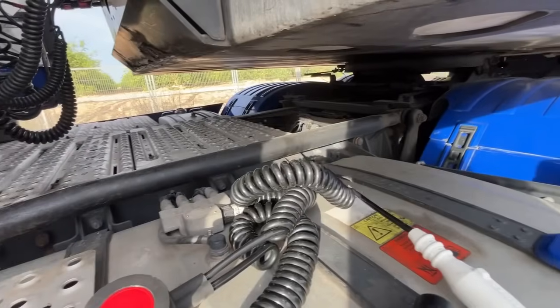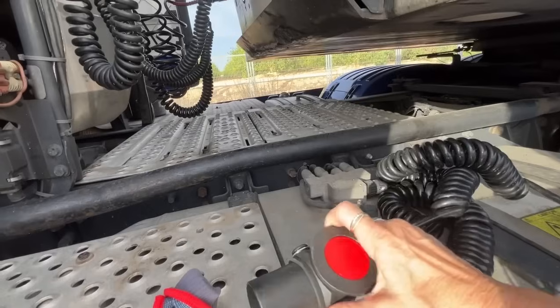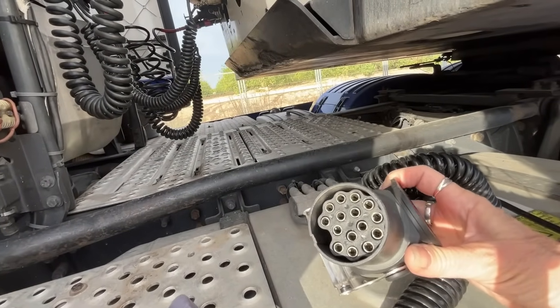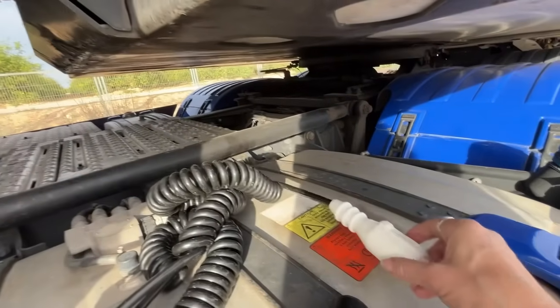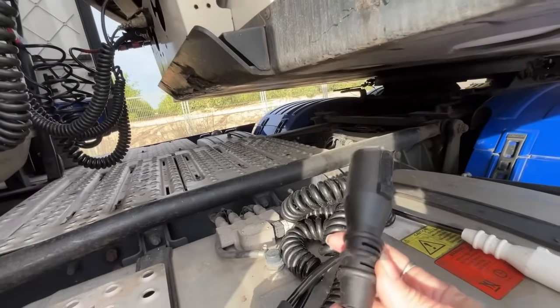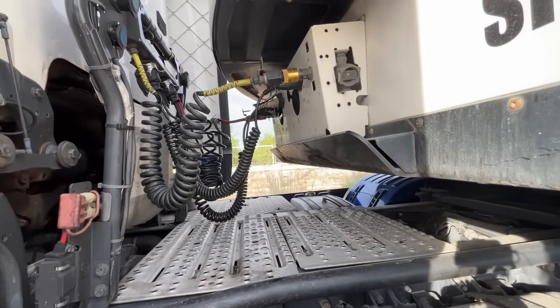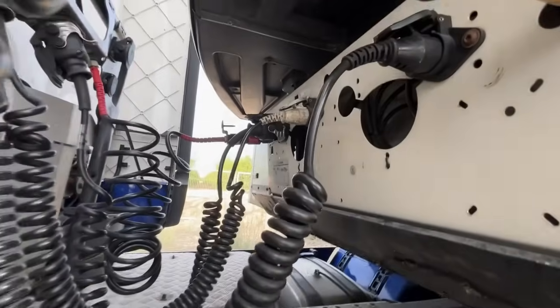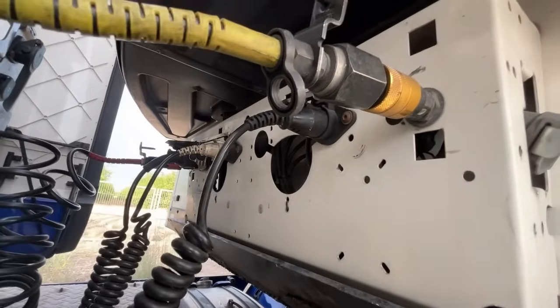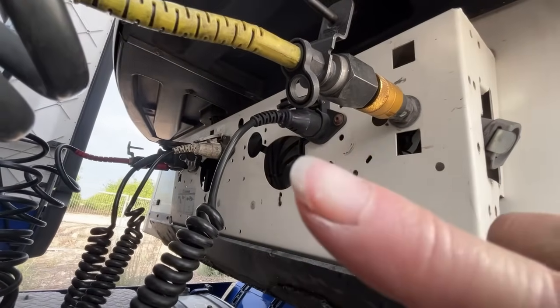So I've got a new Susie. I don't know why they're called Susies actually — I'm sure somebody would be able to tell us. Sorry, there's some people loading the trailer behind me. This one's new. It plugs into the vehicle and it goes into pins. This is the female end that goes into the vehicle and then it comes out to two ends — that's your auxiliary and this is your main one. I would say there is a problem in the one that's still on there. Those two just plug into the trailer corresponding to the trailer. There is a problem with that somewhere in there.